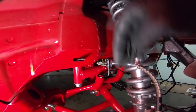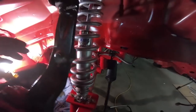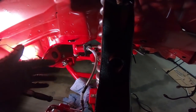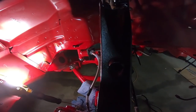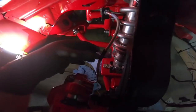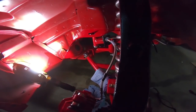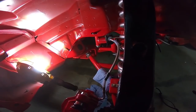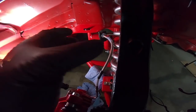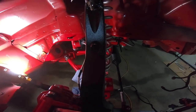I ended up putting two washers here to pull this down a little bit so it wasn't rubbing on top. You can see where the paint scratched, but I went ahead and zip tied this down and I think we are good here. I've moved the wheel lock to lock. The only thing that bothers me a little is it looks like this is resting on the strut spring, but I think once it gets the suspension loaded that's not going to be an issue — it should be right in between. I bent it just a hair out in order to pull it away. That's the best spot for it.